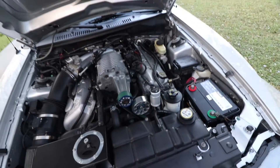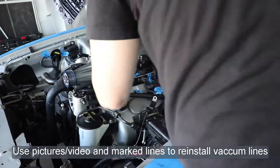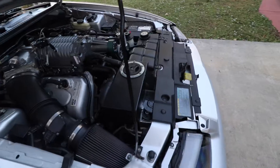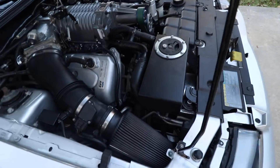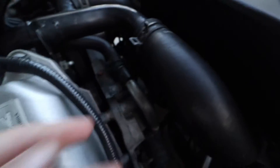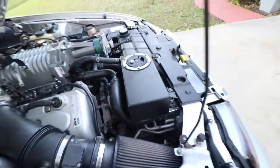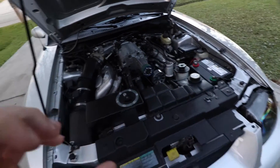Other than that it's honestly been smooth sailing putting everything back together. I used a lot of the videos I took, went back and did some research, and had paper printouts — things that helped make this process a lot easier. I had a little hiccup and it had nothing to do with the blower; it was actually with the water box — the water tank for the supercharger. The line that returns to the supercharger was rotten, so I had to cut a little bit of it and it wouldn't connect. I went to Home Depot and had to create a PVC connector.